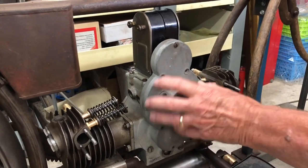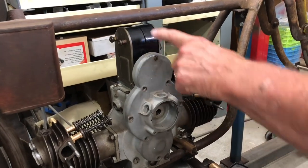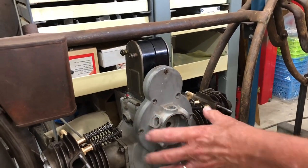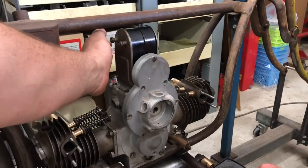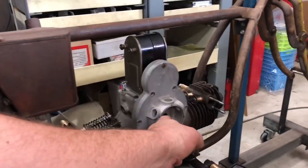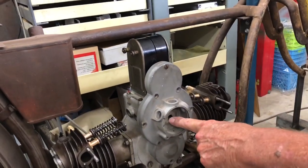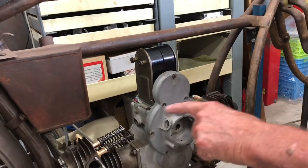But there must be something different here, because definitely — so this is running at engine speed. That's engine speed, yes. Cam speed back down to engine speed or back up to engine speed. So this is firing every time, and this is distributing when each cylinder needs it at cam speed, of course. So it's the trigger for the timing on this side. Basically, as long as you've got the rest of the circuit connected, the timing is actually set when it fires? Well, this will fire twice the speed that this fires. So this will fire once there, once there.